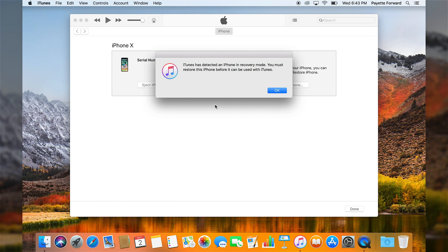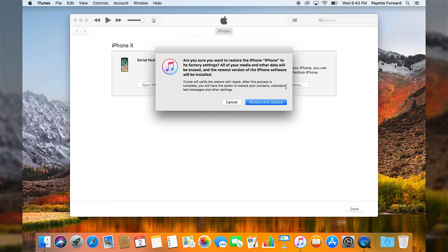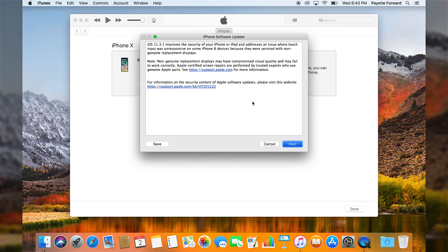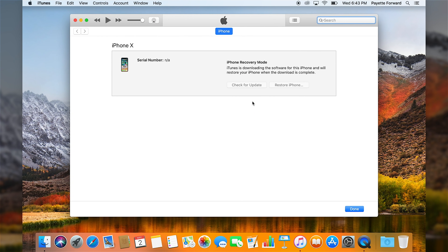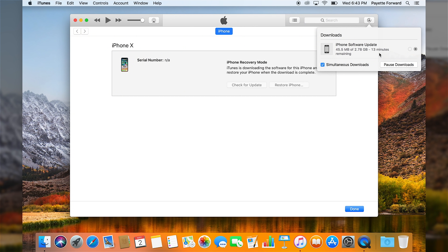So we've gotten it right. We're going to hit OK. iPhone recovery mode — screen is black, DFU mode. Click restore iPhone. Are you sure you want to restore this iPhone? Probably you're sold on this by this point. We're going to hit restore and update. Your computer will download a fresh copy of the iPhone software, which could take up to — well, 13 minutes remaining here. In 13 minutes it'll go through the whole process of restoring your iPhone, and you will have a fresh copy of the software and hopefully you've fixed it.